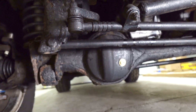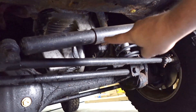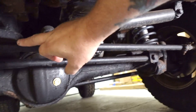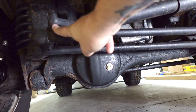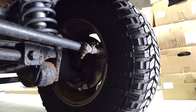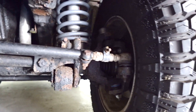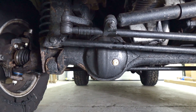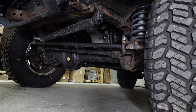There's no real need to lift the vehicle because it's already got a two inch lift, so there's plenty of access. Essentially what we're going to be doing is removing this steering damper here, which looks like the original, and fitting a new Terra Firma one. The steering rod is this piece here - it's got ball joints at each end, so we have to remove the ball joint out of that drop link and also at the other end.